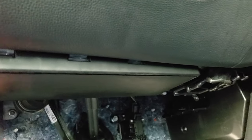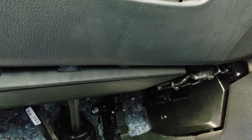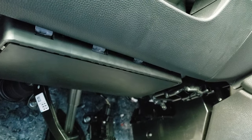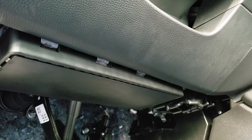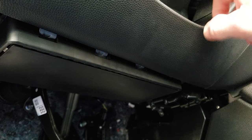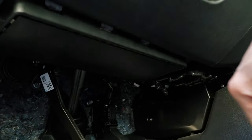It has some play. All I did was pull on it a little bit, and then I pushed it up, and it went away. This thing was causing that rattling noise — you can see there are little metal hangers in here, and this is kind of suspended. So every time I hit slight bumps, it was vibrating. If you are getting a dash rattle, check this thing, try to push on it, and see if it goes away.